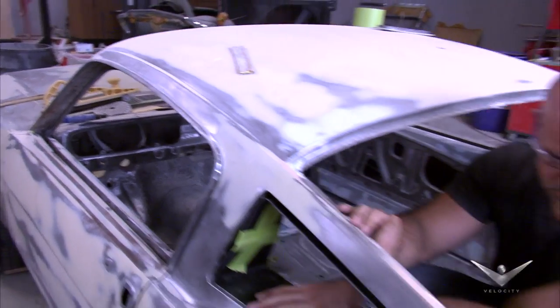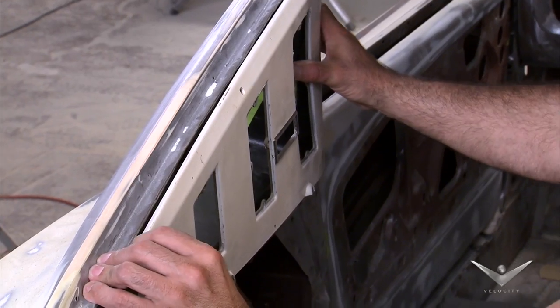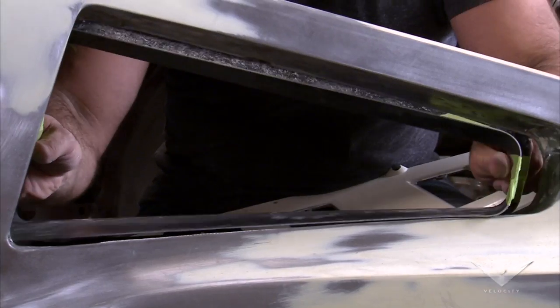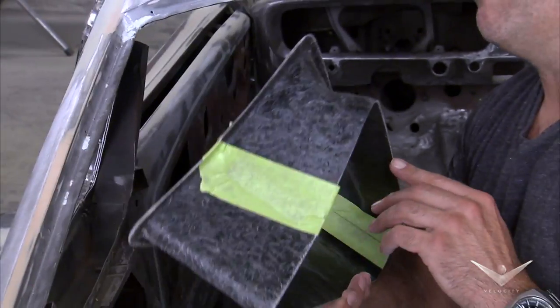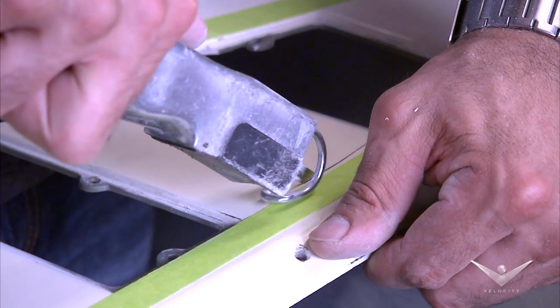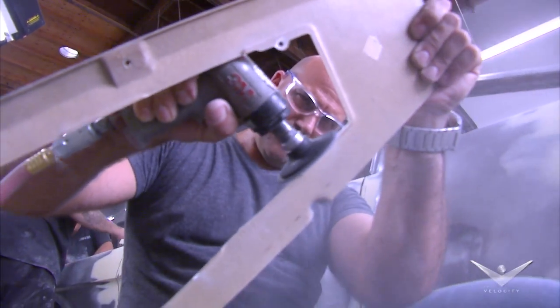A new mod to the Fastback side vents is pretty cool. What I'm playing with right now is the rear quarter conversion kit — it's actually a window that replaces the Fastback air scoops that go on the side, so any passengers sitting in the back would just push these open and that's how you get your little air conditioning going on. The black trim bezel is going to fit in there, so what I've got to do is cut this portion out, use the existing lines that are there, and slip that in.